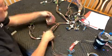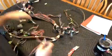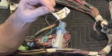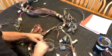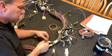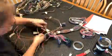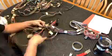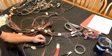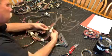I've already removed the wire covering, and anywhere there was a branch in the system, I used masking tape to define it. Then I'm going to show you pictures of each one of the different plugs that I'm removing, and you can identify these all the way back up. I like to start at the farthest point in the harness and work my way backwards up into the C2 and C100, C153, and then the two ECM connectors.